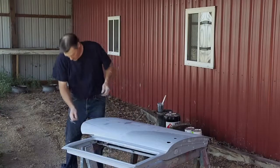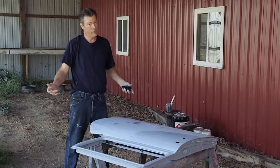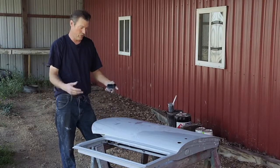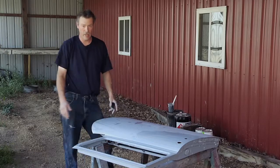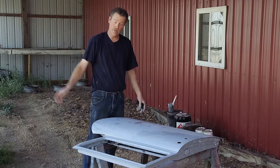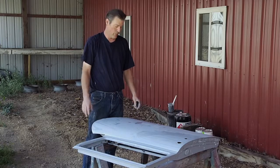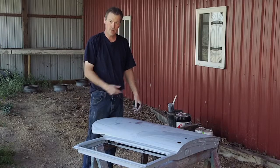I did break through in a couple of spots here on this edge, so there's bare metal showing. We're going to have to put a quick coat of sealer on this. This is definitely not the time to start cutting corners — you've got to have a good epoxy primer against the metal, otherwise the paint is just going to bubble up. So I'm going to get this cleaned up and then we'll shoot a quick coat of sealer on there. Then it'll be ready to flip over, paint the jamb first, flip it back over, and put some base coat on the door.